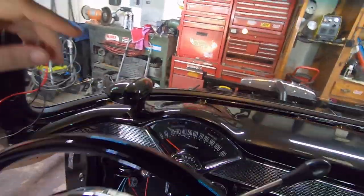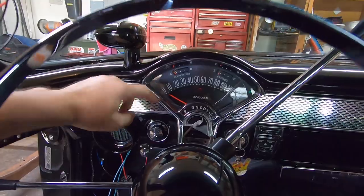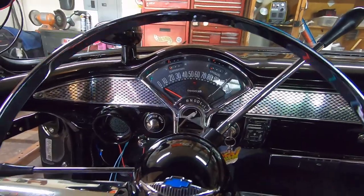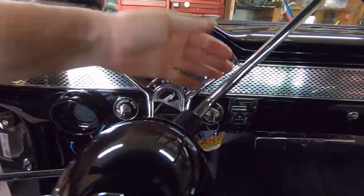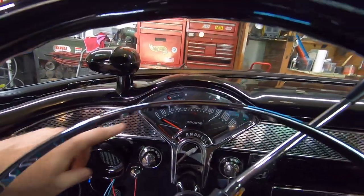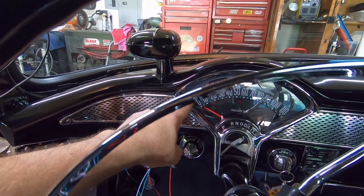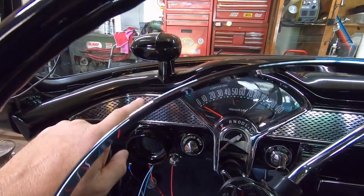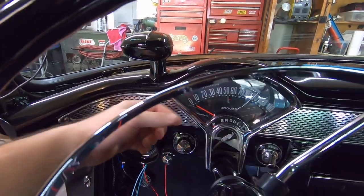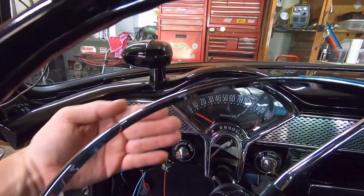The speedometer itself — I put a new lens in it and built that rear panel out of dash trim. It has sides that are bent up just like the factory piece that goes in there, and I even have the little rubber cushions on each end. I notched it and slid those original cushions right back on. They have arrows cut out in the housings for your turn signal indicator; I ended up welding those up, then drilled a hole the same diameter as the LED light and tack-welded a washer on the back so the LED fits flush — the lens wouldn't hit it because those little LED lights are domed.